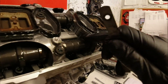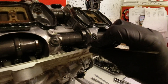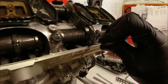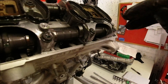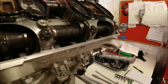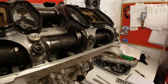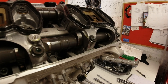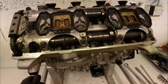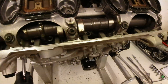To measure the clearance underneath this, I've got a feeler gauge and I'm going to slide that in there — and that slides in quite nice and easily. Then I get the next size up, try the same thing again — look, doesn't go in at all. So I know that the clearance is bigger than 0.2 of a millimetre but smaller than that, so probably 0.22mm — which is handy because the clearance allowance on exhaust cams on a BMW is 0.2 to 0.26mm, and inlet is 0.14 to 0.2mm. I shall go through, turn the engine round, and two by two do all of these clearances and make sure they're all in spec.